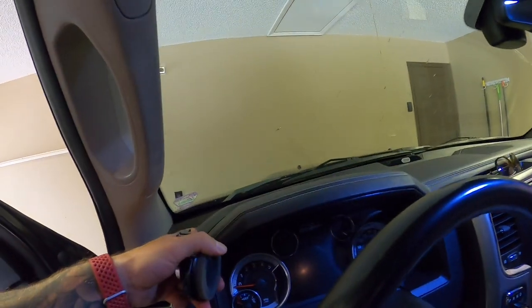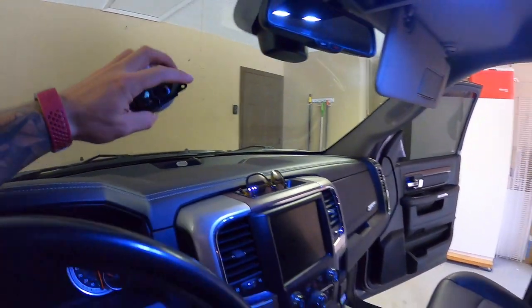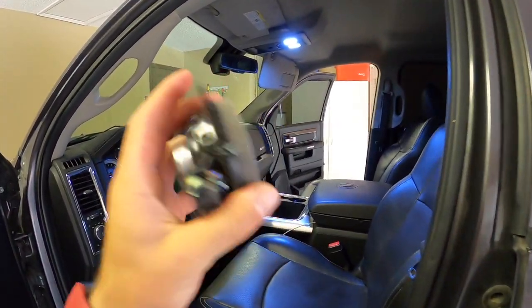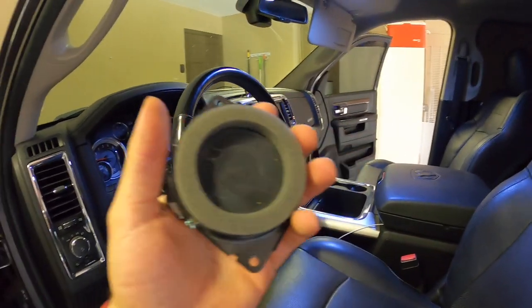These are drop-in speakers that fit right into the front. This is a Laramie truck with a factory Alpine system. We're going to pop out three grills, do a sound test right before, swap in three of these, and do a comparison one by one. When we installed these on our other truck it was a huge difference — much louder, a lot more clear. After about volume level 25 these trucks don't really get any louder. It made our other 8.4 Uconnect system with factory amplifier really, really loud, so hoping for the same results here.